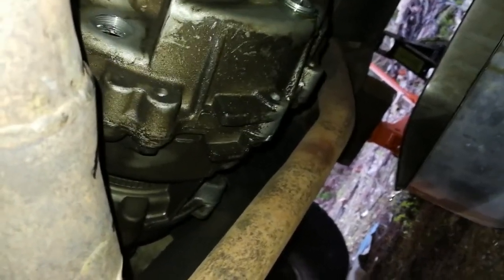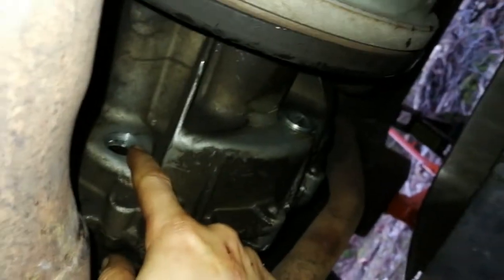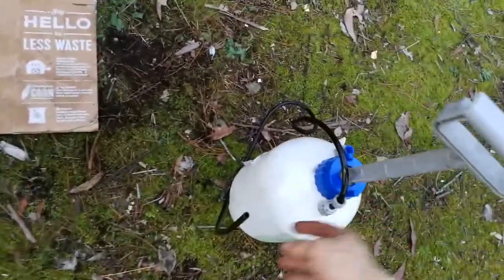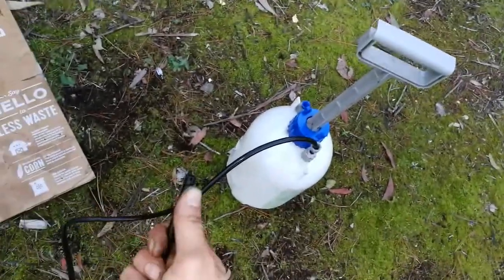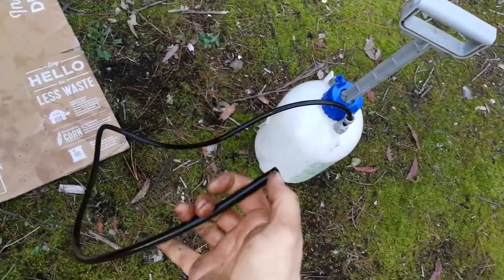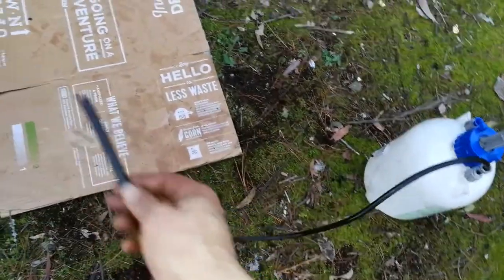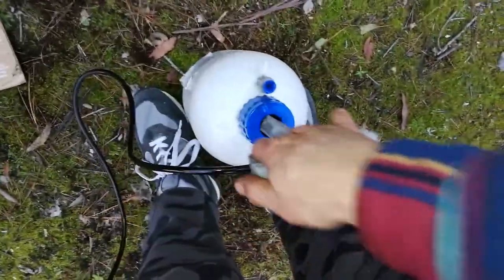So all I have to do now is get a pump and pump the ATF into here until it comes out. This is just a high-pressure hand water pump — I bought it from a shop, Bunnings — just cut the tip off with a knife, cut the handle off. Now this goes into the filler hole and you can stand outside and pump this.